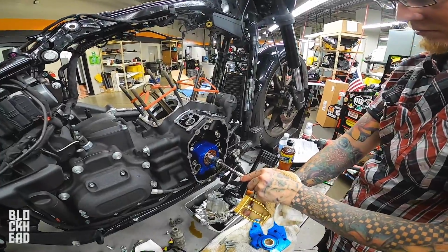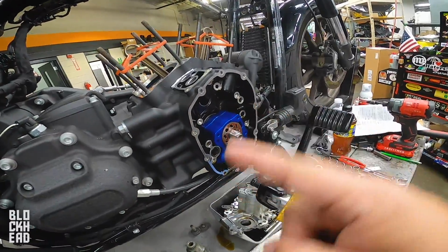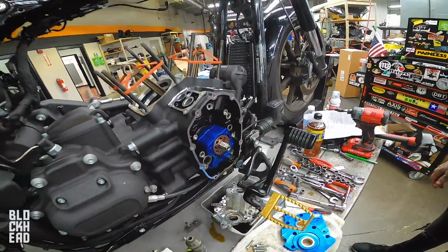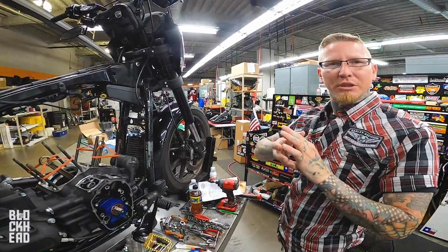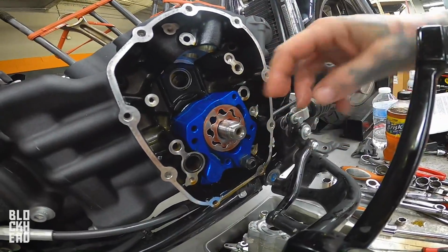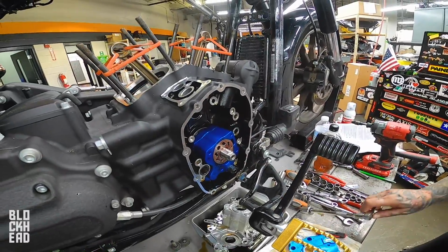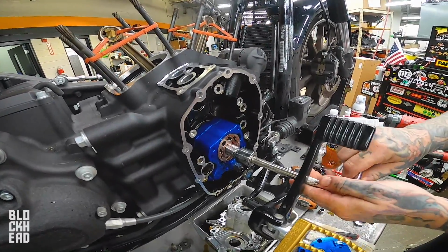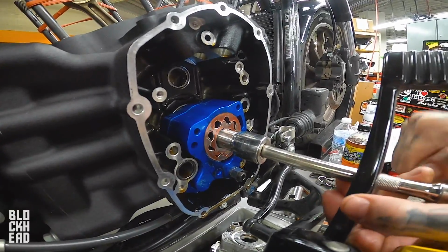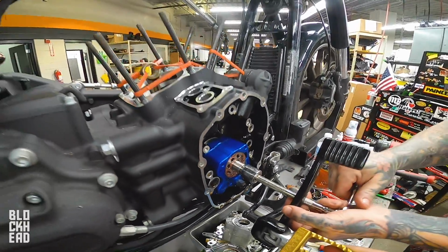All right, guys, so he has installed the S&S pump. He's basically demonstrating how the pump works, spinning it around. So the gearing just fits in and squeezes it through? Correct. They're constantly opening and closing in different places. So this is closed up right now. This side's open. Oil would come in. This would crush it, move it through. When you don't get to see an oil pump work, it's kind of neat to see it move. It just moves at a much higher speed than we're moving. Right, nice. Awesome, man.